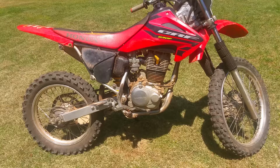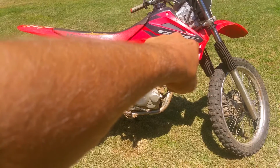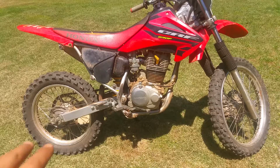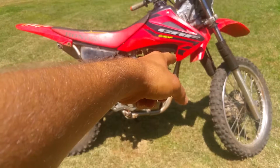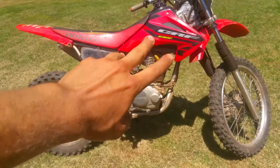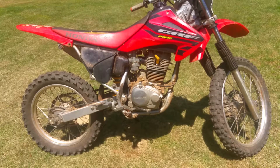So you can see I have the exhaust off right now, and I'm gonna give y'all a close-up of the exhaust port before we get started, because it's all carboned up, and I'm going through this thing and cleaning up the whole exhaust system. So I wanna run some seafoam through it right now with the exhaust on there, and then I'm gonna burn out all the carbon out of the exhaust, and then clean that out and repack it so that hopefully it'll be nice and clean.